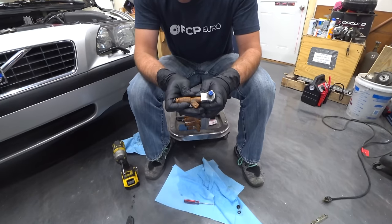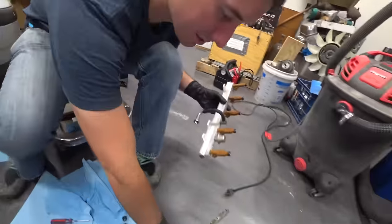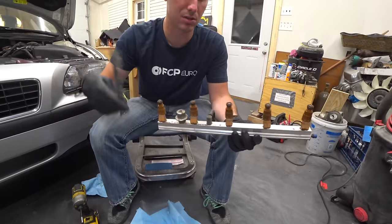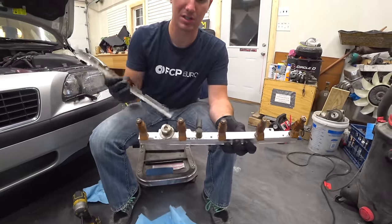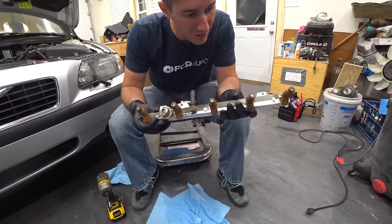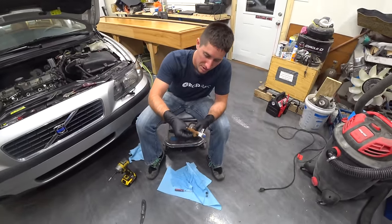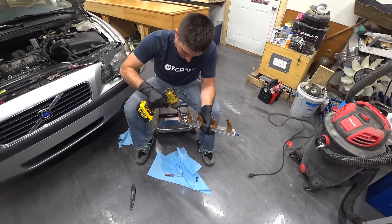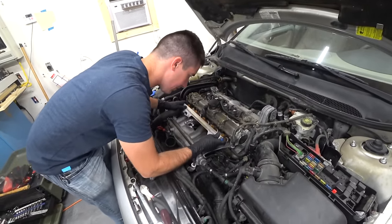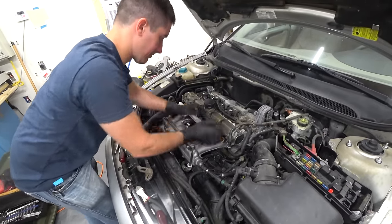Push just a little bit. These have a little slot and the slot is locked in by this rail here — this rail should only fit on one direction. It goes on just like this, and every bit of this should lock into place as you slide it on. There are three T25s that hold the little clip onto the fuel rail. Now we can go ahead and set our fuel injectors in here carefully — give them a big wiggle and a push. They're going in.